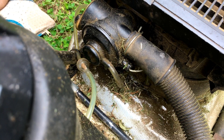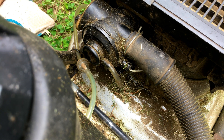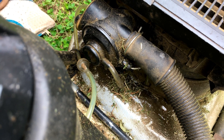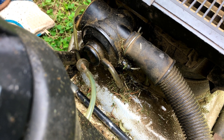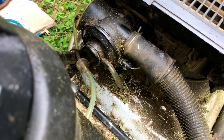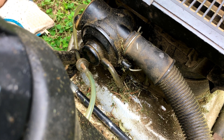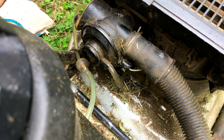Alright, first of all let's have a look at our stop switch and where it lives. Here's our carby and our stop switch is just in here. It comprises of two wires and a couple of grommets, and that's about it. If I move the throttle you'll see the wires wiggle. As I move it up to stop, that wire just cocks sideways a bit. It's a very basic operation and when it's brand new and everything's adjusted right and the grommets are in good condition, it works fine most of the time, but sometimes it just doesn't.